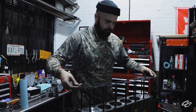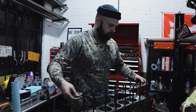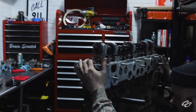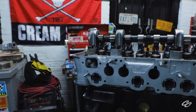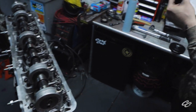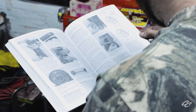We're using an OEM Nissan Performance head gasket on our motor, which has a compressed height of just over a millimeter — nice and thin, which is what we're looking for. Again, we're after high compression. We had the guys over at Westchester Crankshaft in Queens shave our head by two millimeters, shim our cam towers, do a three-angle valve job, and re-polish our Crane cam. They did an excellent job on all of that. Even more exciting is that the rough math on all this should have our motor somewhere in the neighborhood of a 10 to 1 compression ratio.